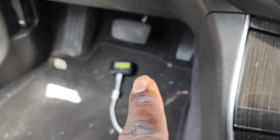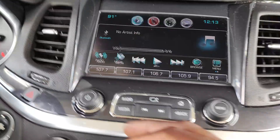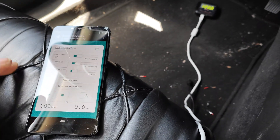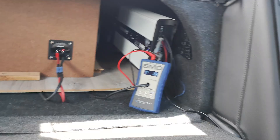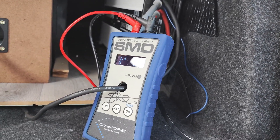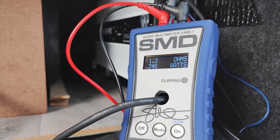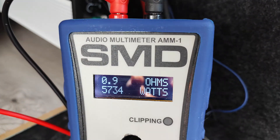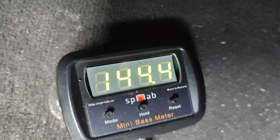Everything is reset, set to 47 Hz. I'm going to turn the amplifier gain control all the way up, then creep the volume into this 47 Hz test tone and see how much the subwoofers can handle. We'll check the SPL score after. We'll hit start — that's 47 Hz, keeping an eye on power from the SPL Lab. That was 5,734 watts at 0.9 ohms of impedance. In the kick we have 144.4 dB.